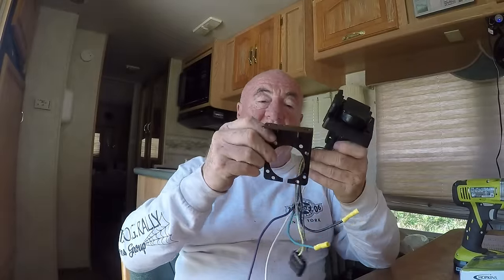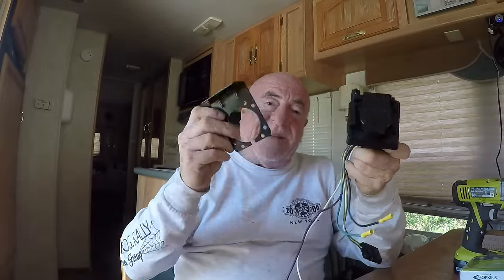There's another set of three wires plus a white wire — the white wire is the ground, and I'm going to reuse that as a new ground. The other wires are for additional options available with the seven-blade round connector, such as electric brakes on a trailer. I'm not going to use them right now — they already have crimped ends. I'll bundle those up, put tape on them to keep moisture out, and wire-tie them out of the way. Here's the mounting plate that will get mounted onto the RV.